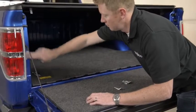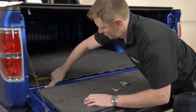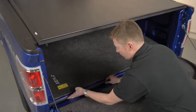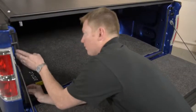To install the TruckSeal, first clean the surface with the supplied alcohol wipe. Peel off the backing and apply the TruckSeal along the end of the tailgate. Press firmly. Then go back and attach the two side pieces. Total installation time should be less than 5 minutes.